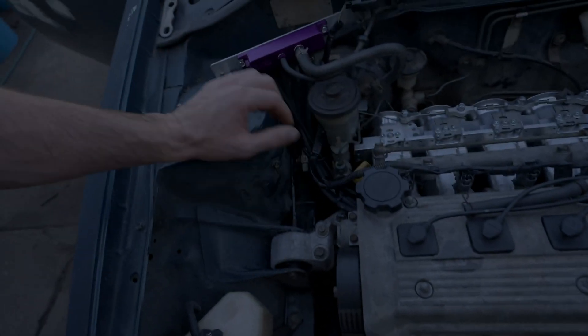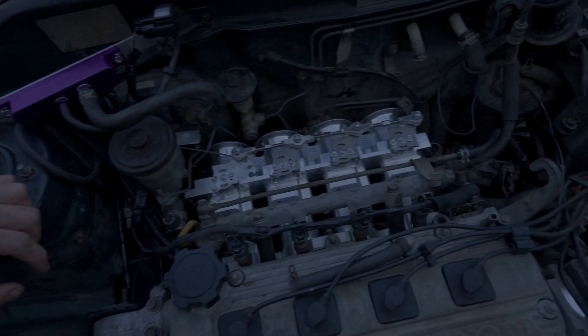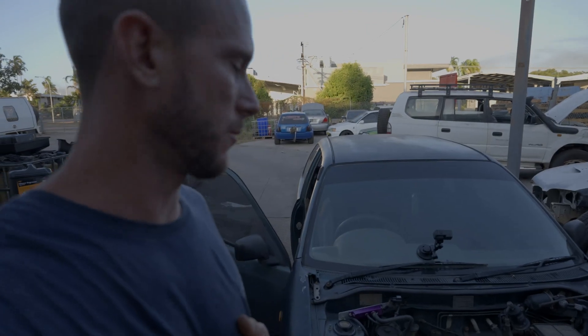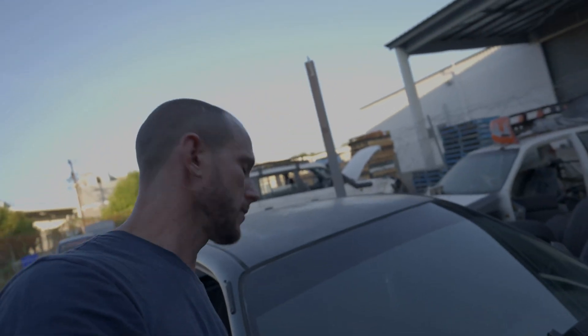The accelerator cable is now on, the vacuum lines are all on, it's all ready to go and ready to fire up. I'm not going to lie, but I've already had this running and encountered a problem straight away — the throttle flaps are not sealing properly. This just goes to show the importance of why we check all these before we send them out, so that we know they're right.